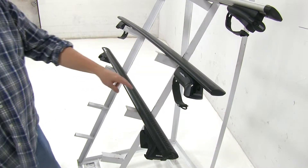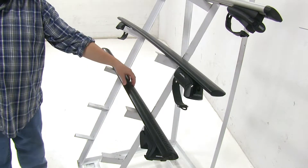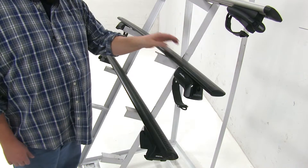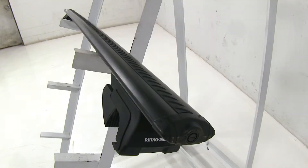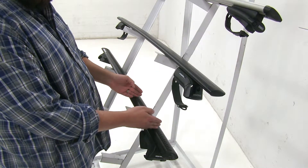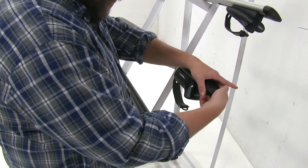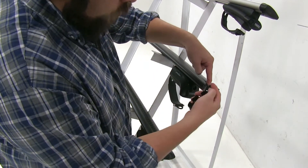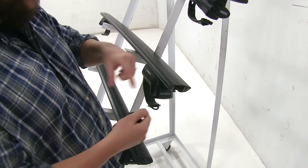With all three bars, they have a strip up at the top, and that, coupled with the shape of the bars themselves, cuts down wind noise and drag while driving. However, the Yakima is a little different. With the Rhino-Rack and Thule bars, you have to remove the strip, place in your accessory, cut the strip to length, and put it back. With the Yakima, instead of a strip that pushes into place at the top, you have a strip that pushes down — so once you install your T-track accessories, you don't have to remove or cut the strip at all.